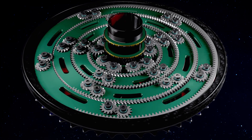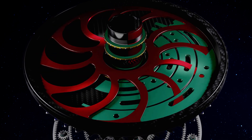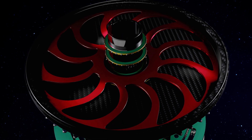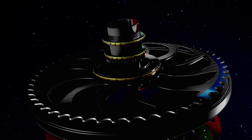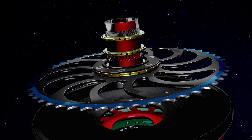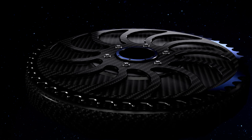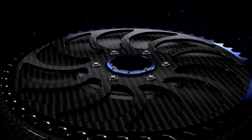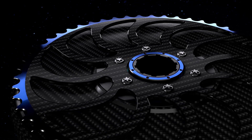Below all the cogwheels comes the second layer of carriers. Then the inner chainwheel rotation distributor, which is connected directly to the outer one. The bike's overall general gear ratio — whether it should be low geared for mountain biking or high geared for road racing — is determined by the size of this replaceable chainring on the back of the gearbox.